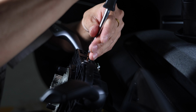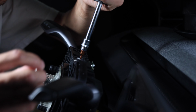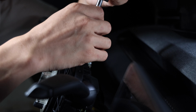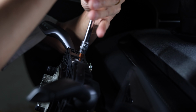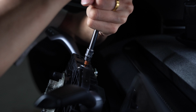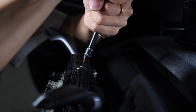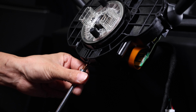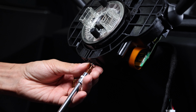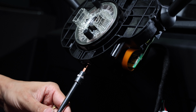So there's screws on top of each of the columns. You want to make sure that these are tightened up, hand tightened. Don't use an impactor, that will potentially strip the plastic. Take your time with this and make sure the screws are lined up correctly, hand tightened before you actually use the Torx screw or screwdriver to tighten this up. Then you have a couple on the bottom as well. So make sure you also hand tighten this.